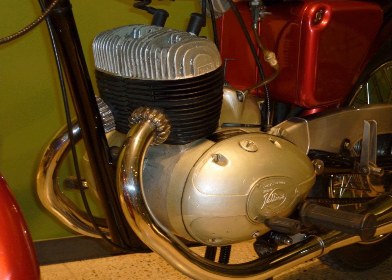Although the rise in popularity of the large V-twin motorcycle has seen the across-the-frame parallel twin fall out of favor, the latter retains advantages over the former. Siting of ancillaries — air filter, carburettors, ignition, etc. — is simpler, potentially making maintenance access easier. Provided a 270-degree crank is used, a four-stroke parallel twin can simulate the slightly 'lumpy' feel of a four-stroke V-twin.